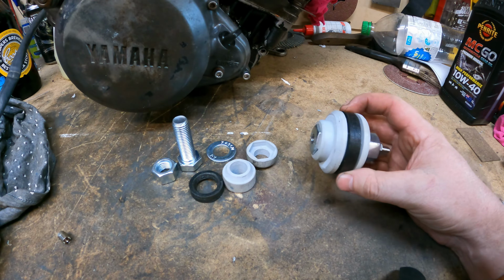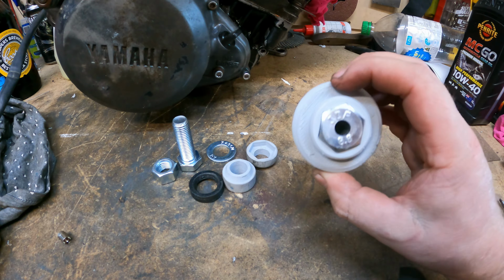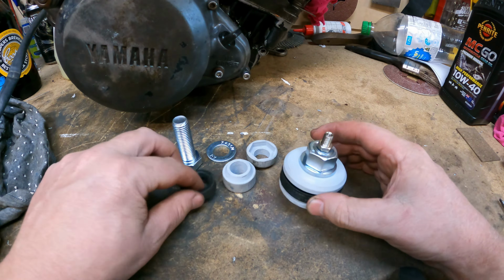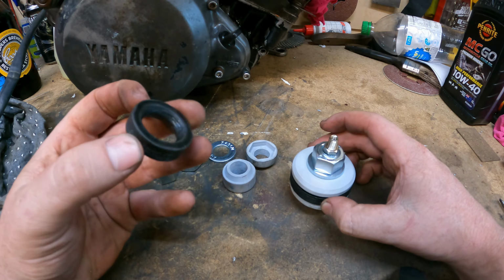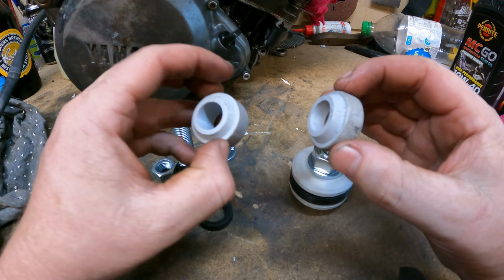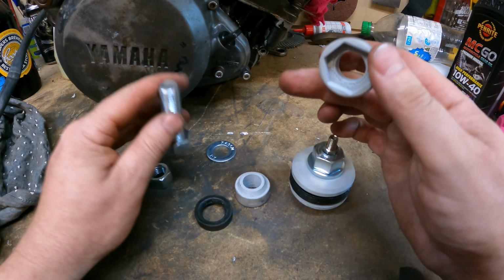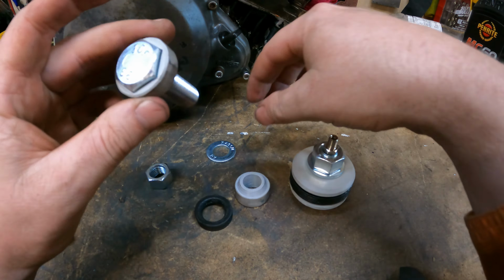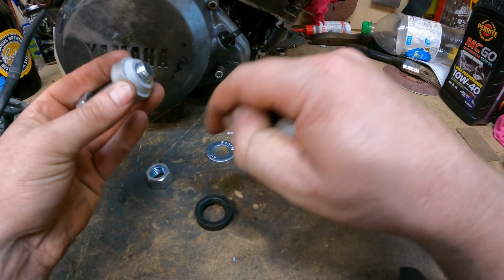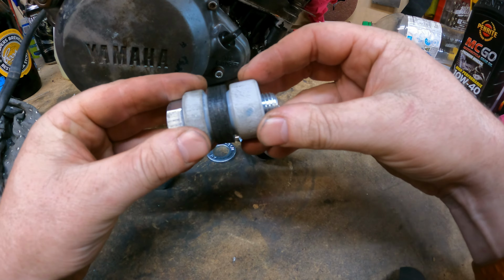Alright, so I've made up these two little tools. Here's one I've assembled. It's got a Schrader air fitting in it and a hole through a bolt, a little TPU O-ring and two little flanges. So this is the TPU O-ring. It's got two beveled edges to match the two beveled edges on this. So the bolt, recessed head, goes in, tightens up against the O-ring and stretches out.